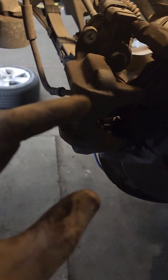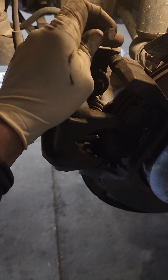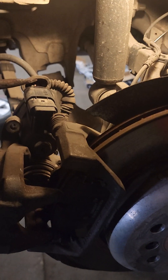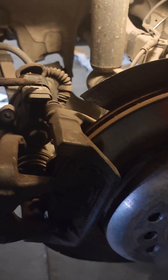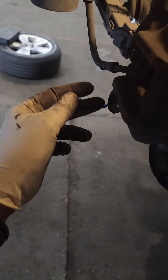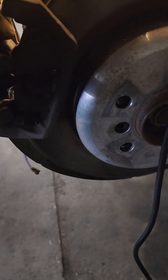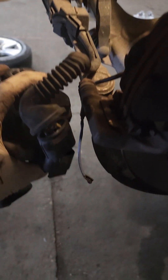So if you're changing the rear brake on this car, you will see this piston. I already opened everything — it has two bolts, 14mm, sorry, 13mm. Get a small screwdriver and gently remove the electrical connector. There is also a brake sensor you can remove gently too. Once you remove those, move the caliper out.